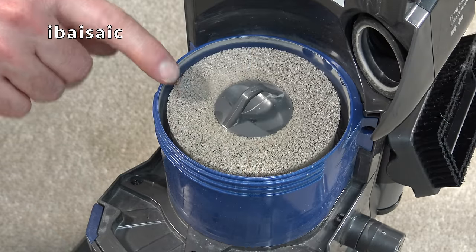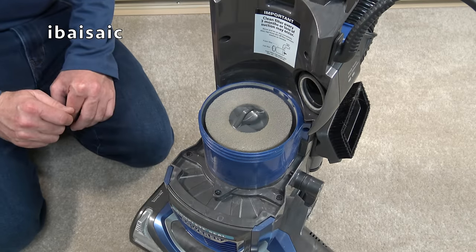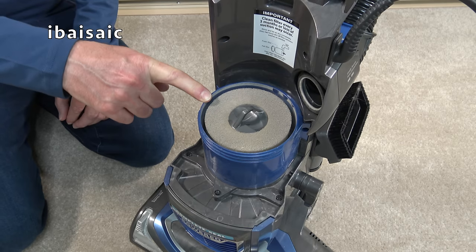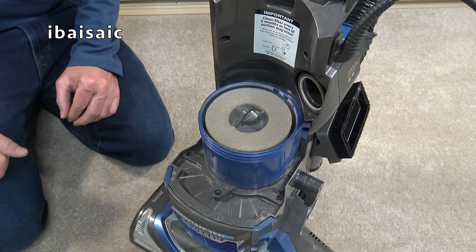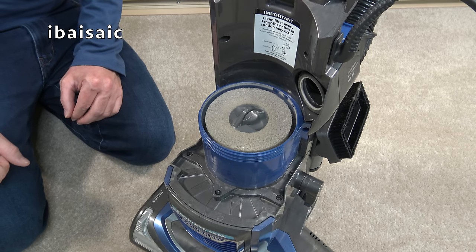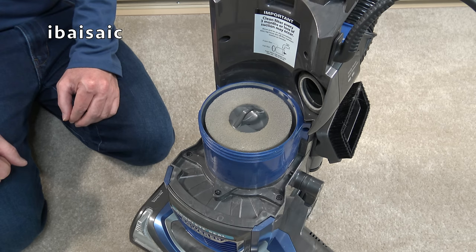The filters are like the lungs of your vacuum cleaner. If they become clogged up, it reduces the airflow and reduces the pick-up efficiency. In most Shark upright cleaners, the pre-motor filters are located directly under the bin and you can see them every time you remove the bin for emptying. Shark recommend cleaning these every three months, but that depends on usage. Personally, if they get very dirty, I would clean them more regularly — perhaps once a month.